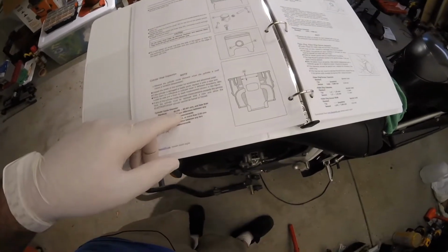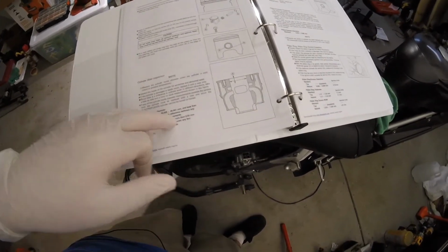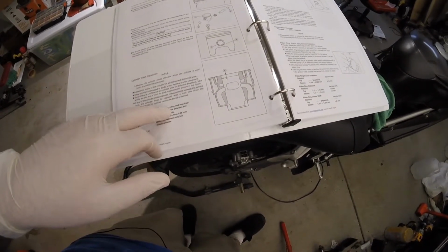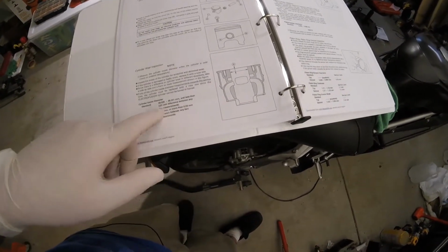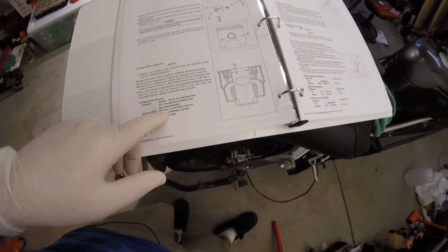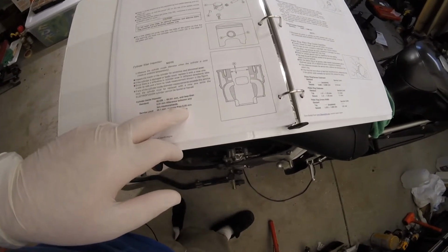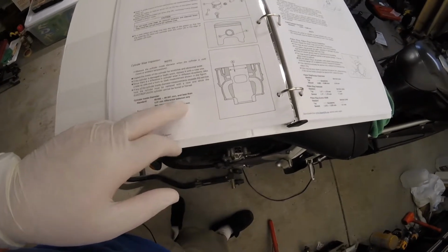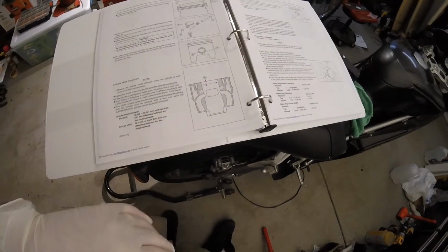It's actually read a little low. That's probably my measuring technique. But we know that we're not above 66.041 millimeters, so the cylinder does not need to be replaced. And there is not 1/2 of 1/10 of a millimeter difference in any two measurements there.